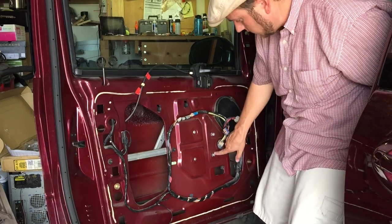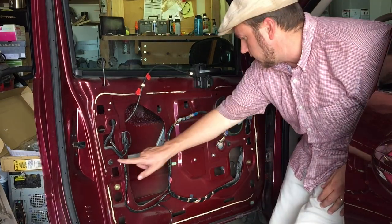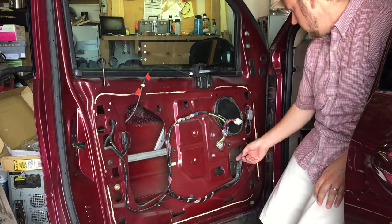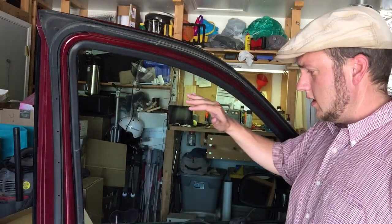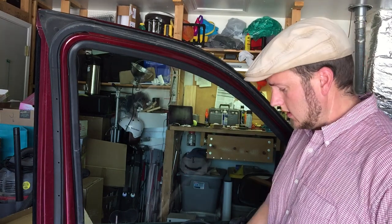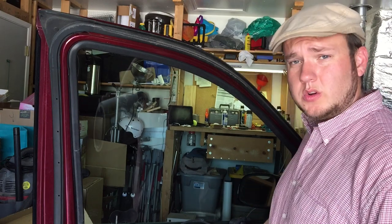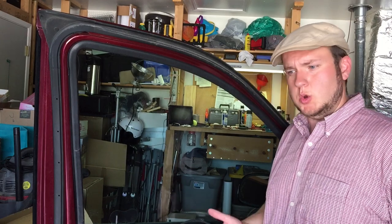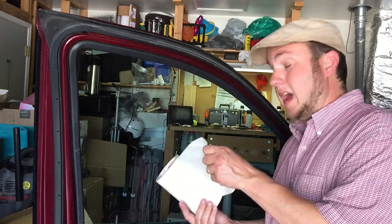I see there are four rivets here that hold on the main assembly, and some nuts and bolts that hold on the rail. There's the motor right there. The irony of all this is we're going to need to lower the window at some point in order to remove the screws that attach the glass to the assembly. The instructions tell you to lower the window by attaching the controls — I'm curious who replaces their window regulator if their window actually rolls down. I certainly cannot follow that step.